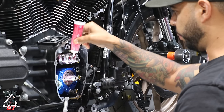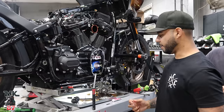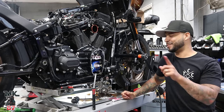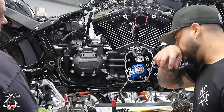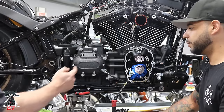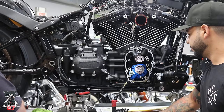Then we just put the cam plate over it and push it all together? Put the cam plate over it, and we're going to torque it down in the proper sequence. Okay. With the Loctite. Sweet. So, am I officially a wrencher now, or what? No. You're close. You're not officially a wrencher until you have your own tools. That's right. I do have some at home, but it's only like three of them. Anything in specific that we should let everyone know when installing the oil pump, or plate, or even the cam? Yeah, make sure you don't tear the O-ring all the way on the inside or the bike will sump. And make sure you don't forget that O-ring, because then you gotta reopen everything up. Two important O-rings.